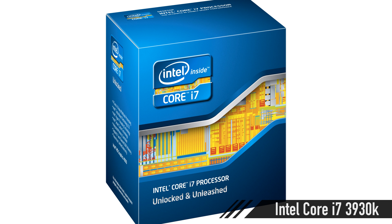Starting off, we are going with the Socket 2011 Core i7-3930K. It's a 6-core running at 3.2 GHz. The price-to-performance ratio is not so hot, but you can overclock it quite a bit, and the per-core performance is just insane. I love Socket 2011 — you get 4 channels of memory support. You can do so much with Sandy Bridge-E, and Ivy Bridge-E is coming up pretty soon, so that's going to be nice.